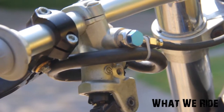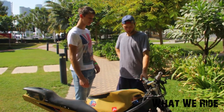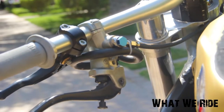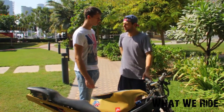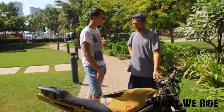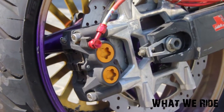The handbrake is a clutch pump from the Ducati 749. It's a clutch pump — it's good because it's convertible. You can put the banjo on each side, it's like the same frame, you can mix it. You need a very adjustable handbrake and clutch setup for stunt riding, since some guys have longer fingers than others. It's 15mm, so quite big. It's pretty good for handbrake — from 2 calipers. I like it's a smaller, soft setup, not too hard.